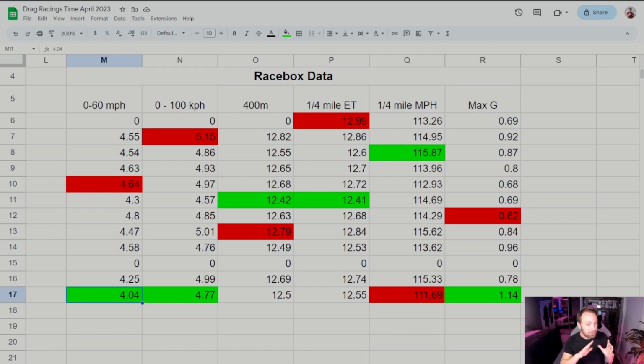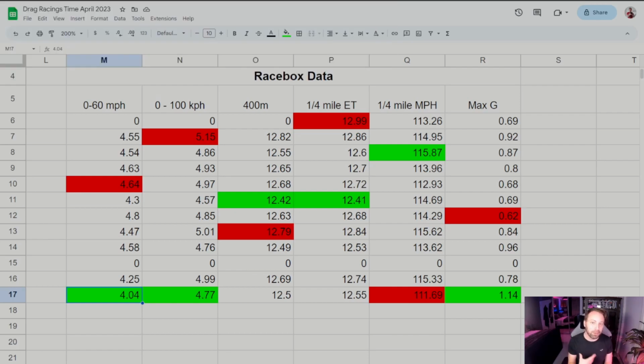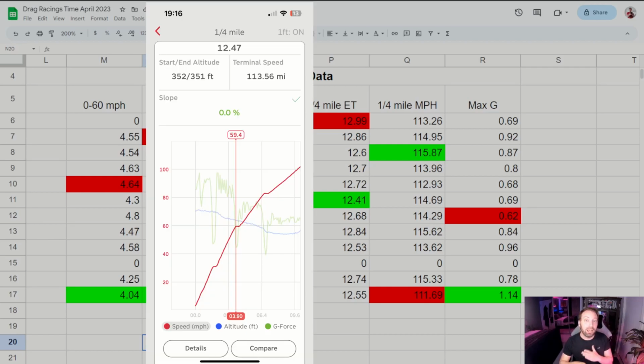Now, you may have seen a video on my channel where I've got a picture of the car and it says 0-60 in 3.95 seconds, and not to say that that was clickbait, but that was recorded on a mobile phone app. Those are obviously never going to be quite as accurate, but I think I have another reason for seeing a fairly consistent spread here. So, looking at the data from the Racebox, what's clear is my second gear pretty much tops out dead on 60 miles an hour. So whilst on the dial it's indicating more, the GPS data puts us directly at 60.